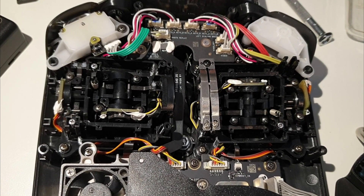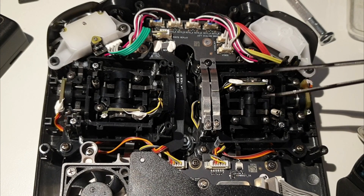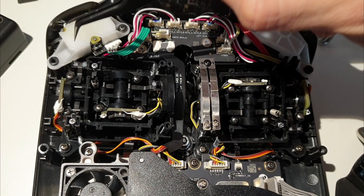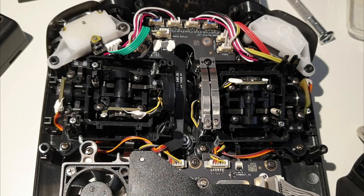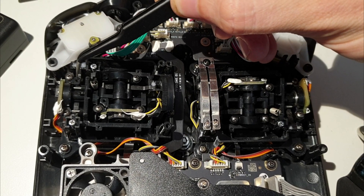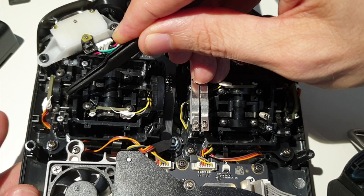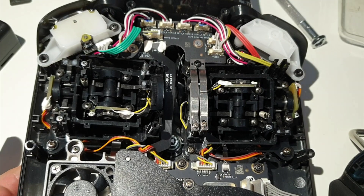Here's the inside of the controller in all its glory. The left throttle stick is actually on the right here because it's upside down, but I can't show you what was wrong because a bit of plastic snapped off. So I'm going to show you on the other one — you can reconfigure these to be mode 1. Here you will see there's a little bit of plastic that juts out. You can put a screw inside that, and what that will do is push down this spring-loaded piece of plastic, which is the return-to-centre mechanism. And once it's pushed down, it fails to do its job of returning to centre.